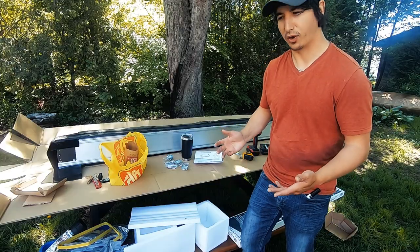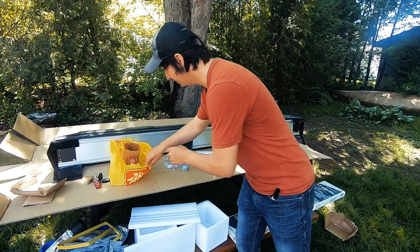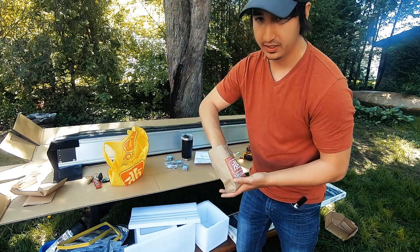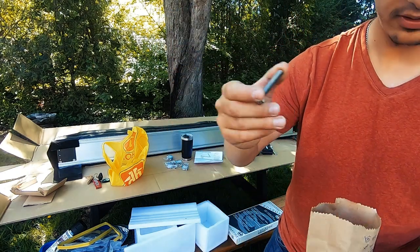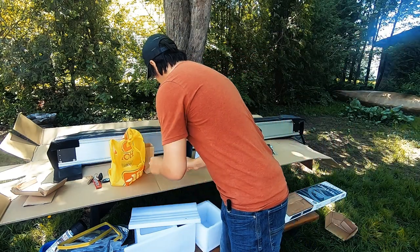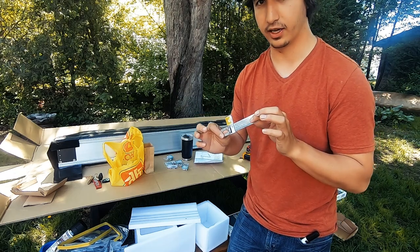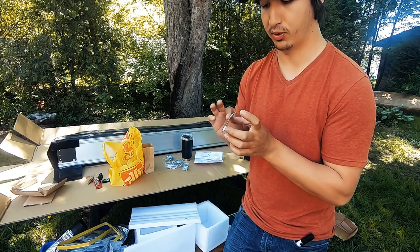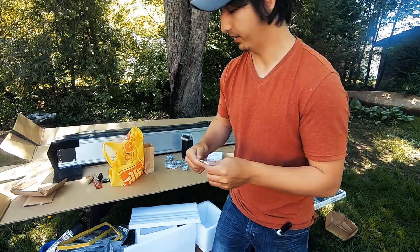All right, I've been to the store four separate times now. I think I have everything I need to mount this roof rack. I went out and grabbed some M8 metric bolts, stainless, with some nuts and washers. And I also grabbed some U-bolt plates, and I'm gonna see if I can utilize this to get four bolts mounted instead of just two. And I'll explain how I'm gonna mount it to my roof rack here.